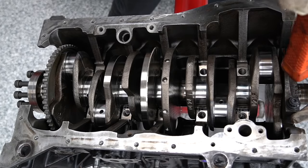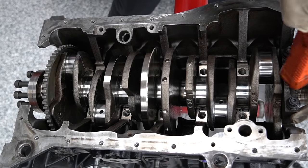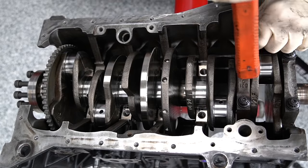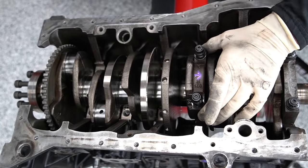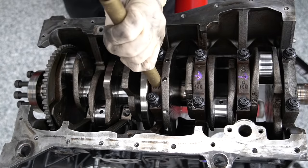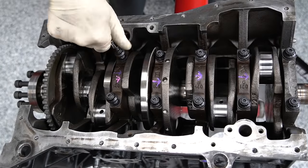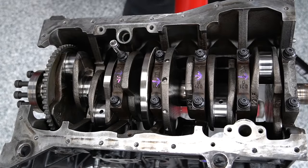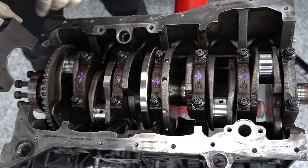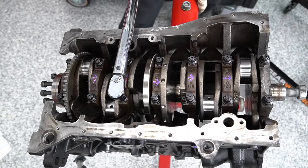You don't want to use the bolts to run the cap all the way down — just give it a tiny gentle tap with a mallet to seat the main cap. You don't have to worry about the thrust washer at this point since we're going to take the crankshaft back off anyway to check our Plasti-Gage measurements. I like to clean the Plasti-Gage residue off after — technically you can leave it, but if we're going to take it back off, we might as well clean it one more time.